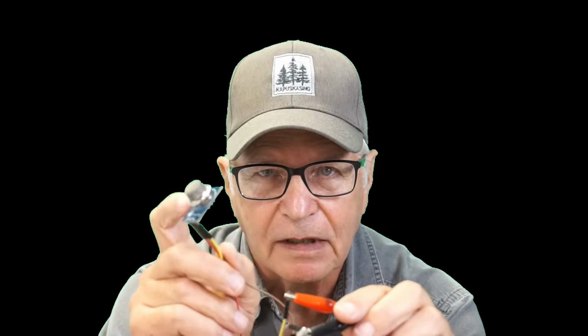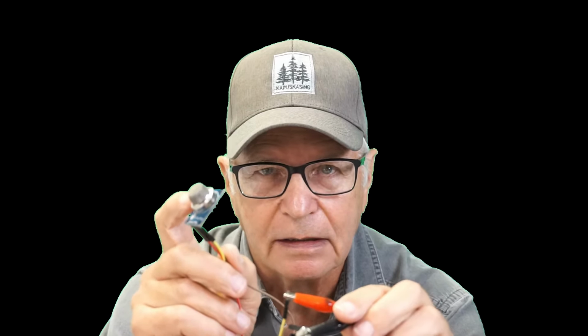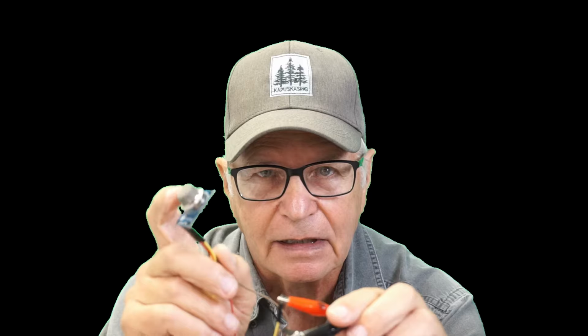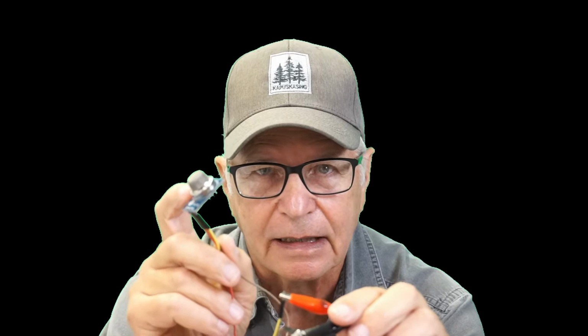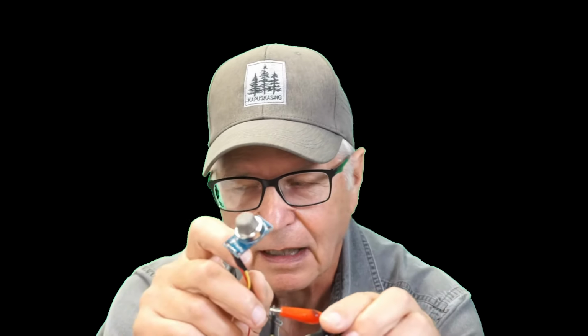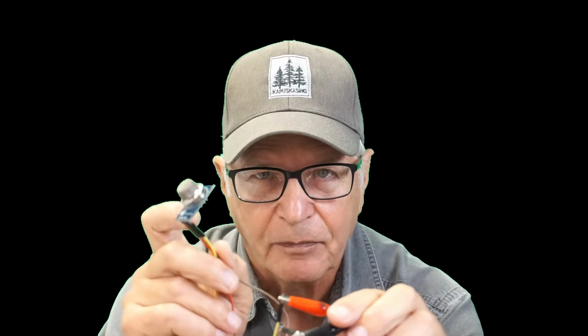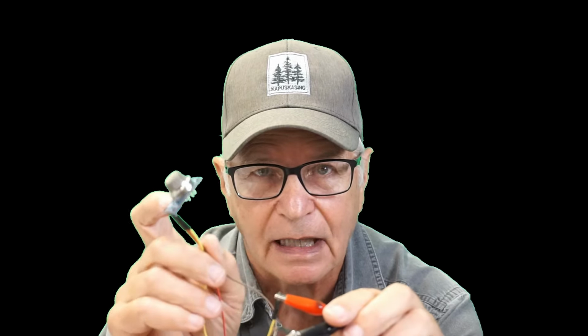As I mentioned, there's a small heater element inside of these sensors. You have to give it a little bit of time so that it can bring the sensor to a working temperature, and then you're able to start taking measurements with it. If you look at the data sheet, they sometimes tell you that it's 24 hours. That's ridiculous. I mean, that would be impractical, nor is it necessary. Depending on how long it hasn't been used, it can take maybe 5 minutes to get to a baseline where it's ready to take measurements, and as little as less than 2 minutes to do so.